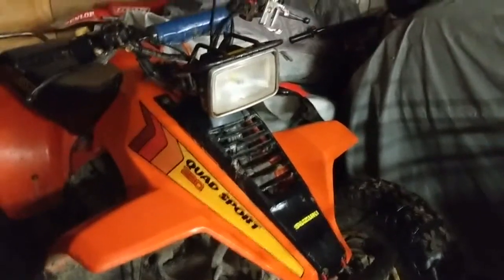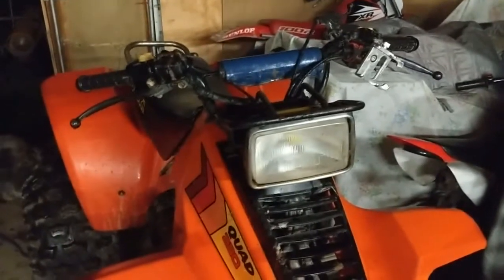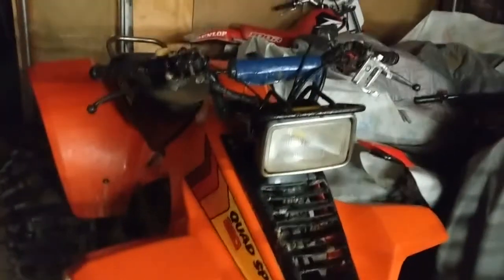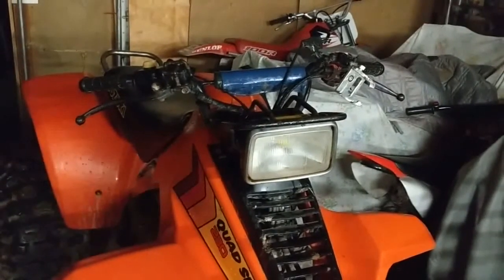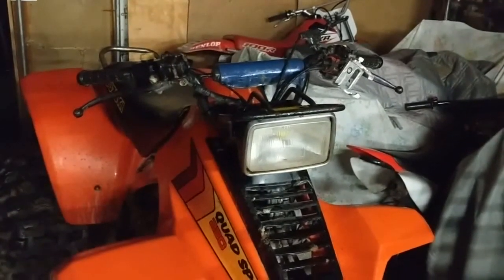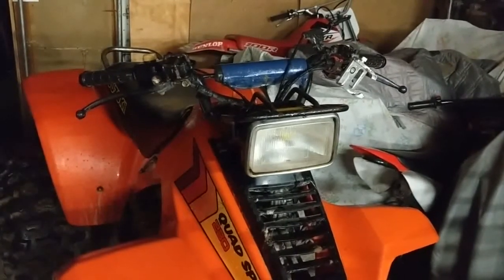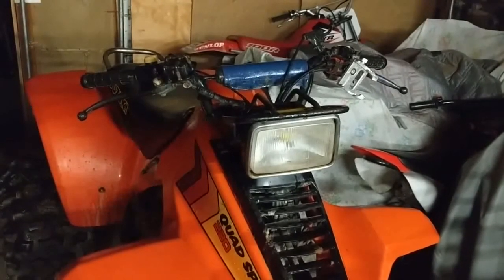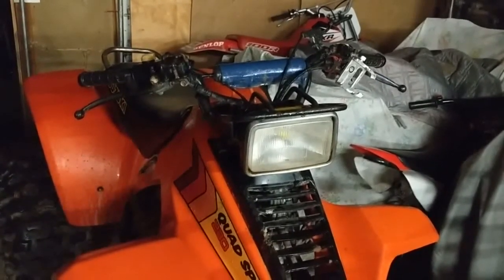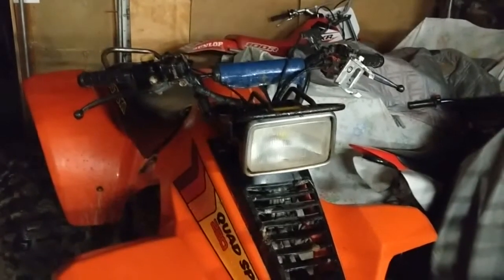To wrap this up: I'm happy with it. You can pretty much see by eye that it's a lot brighter — it's a much more bluish-white light rather than the orange light of the old incandescent. It jumped up about 10 foot candles: I was getting between 18 and 20, and then between 30 and 32 with the new LED. So far so good. How long will it last and hold up on the trails? We'll find out.